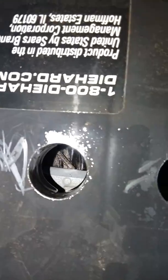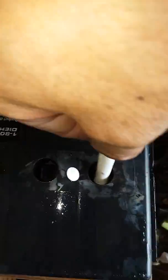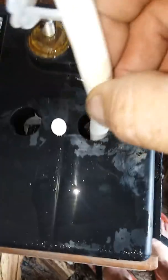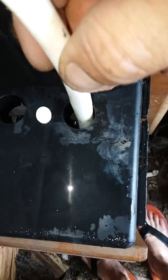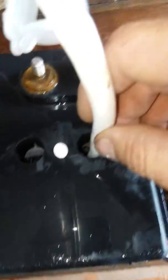I'm going to try and figure out how to get those chunks out, then fill this with new acid. You can see a chunk sitting right across the top there — some of it's damaged plates. This is a used battery, but we're going to go ahead and fill it up. Down the road I'll probably empty it back out to see if the new acid has eaten any of that material out, then change the acid again since it's not that expensive. I'm thinking we're gonna have pretty good luck here.